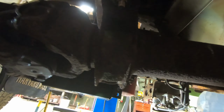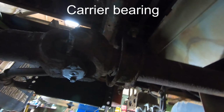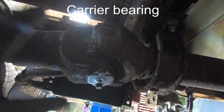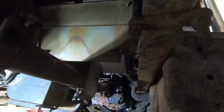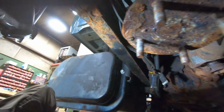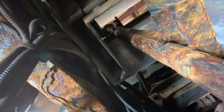All right, so I got this drive shaft back in. I can't remember what that's called. Center bearing. New U-joint straps in the front and the back for the two new U-joints. Torque them to 125 foot-pounds. The rating is 115 to 135, so I just want 125. That's all back in, so I just gotta put the sander chute in, and then should be done. I'll put the sander chute in, put the sander spinner on, and drop this back down and bolt it back in. I just pulled it up and turned it to the side, so the bracket's kind of hung up there.